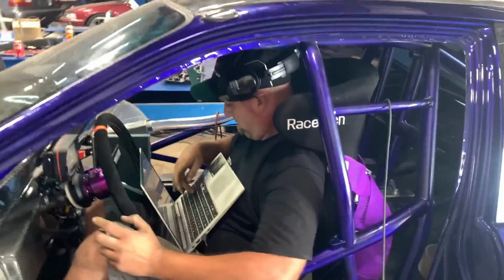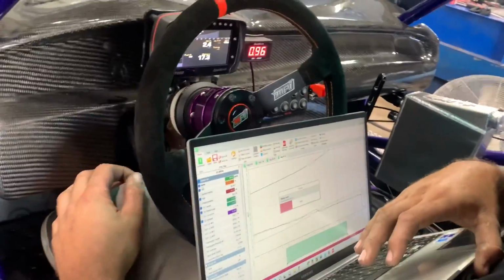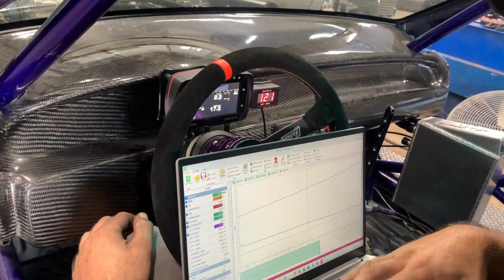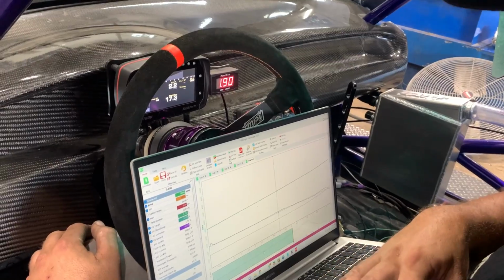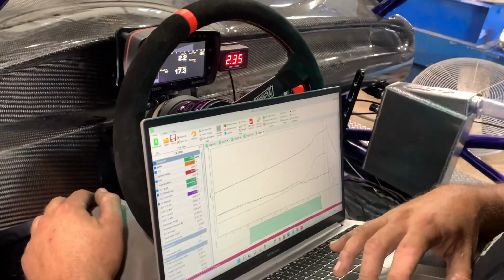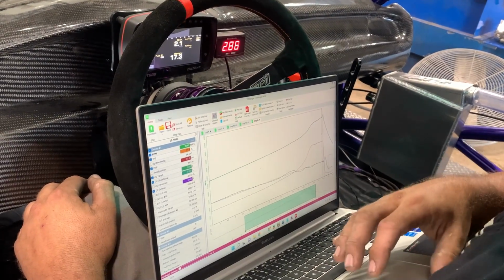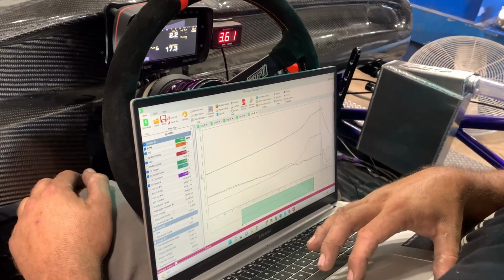Looking good. 7:49, and that was definitely on the right path. It just feels so lazy. Well, you know, if these are different cams, it could be the webs that are in the other cars. Okay. I think that's the same level. 32 pounds, and I called for 25. So we overshot quite a bit. Yeah. Ignition 14 degrees, so that's pretty soft.